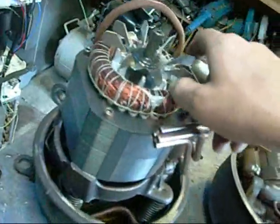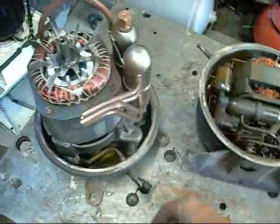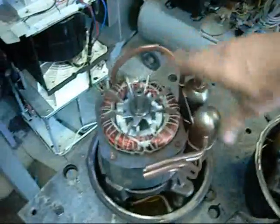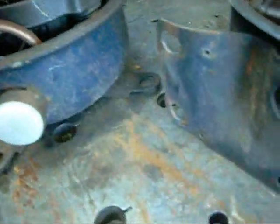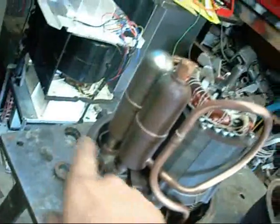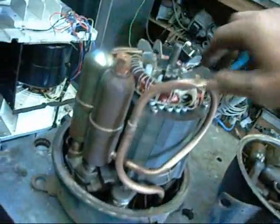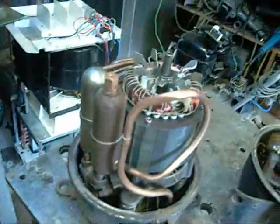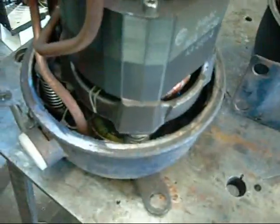There's a little fan thing on the motor - I don't know what that is supposed to do but it is working. Air coming out of the taped up discharge. I might even try and wire it up and run it. There is nothing wrong with it - the unit just had no gas in it, cracked coil or something and leaked out. You can see the motor rotor. The cylinder head is down there with the suction accumulator or suction manifold, and the discharge accumulator with a thermal valve on it. Head pressure gets too high, that blows off and discharges back into the low pressure side. Usual story with a refrigerant compressor, there is nothing too special about them.